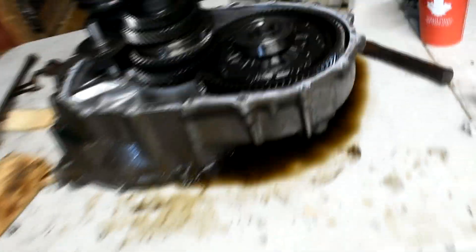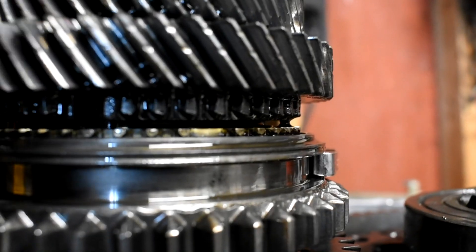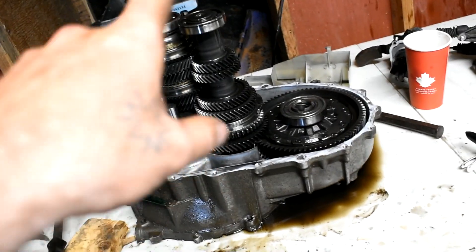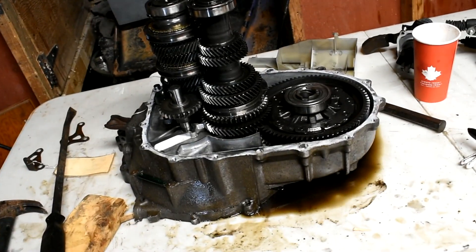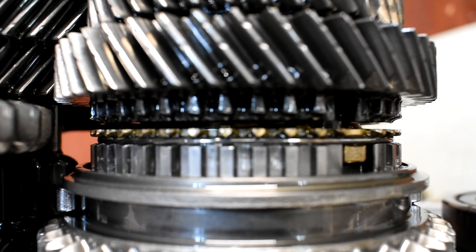So I got it apart — this is the one I bought from the scrap yard. As you guys can see, second gear is pretty dinged up. It shifts fine on the selector but I'm scared to put it in. At this point I have no other choice — trying to pull apart my transmission, press all these gears off because this is the 4.3, put them on my shafts, put my transmission together and hope for the best. Got my trans apart — first gear is pretty bad, second gear is also terrible. First and second are definitely shot in this trans, 100 percent.